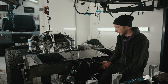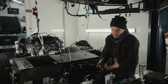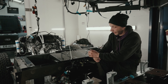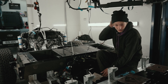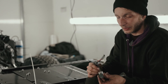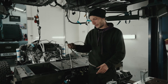The challenge has been finding space for all the computers and modules — there's one extra one with this setup, which is the one for the fuel pump. It's not crazy big, but it needs to be somewhere appropriate, protected from heat. We also need to make sure we've got enough length on the cables, not overly straining anything, with a little bit of headroom for strain relief. Things do move and rattle around, and the wires, pins, and plugs are tiny — the retainer on the plug is only plastic, so if something really yanked it, it would just tear straight away. All this stuff is only as good as the wires that connect it together.